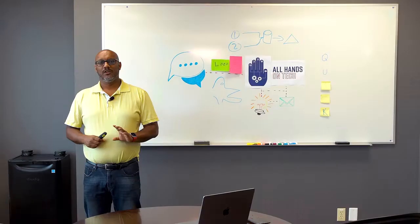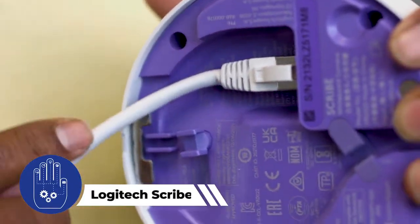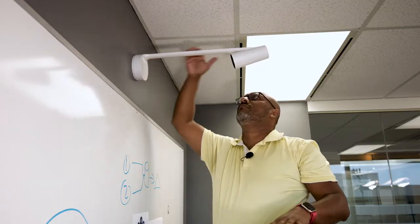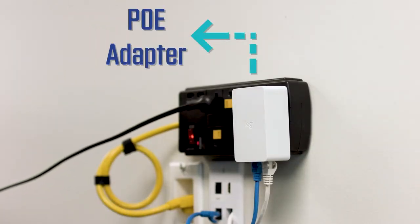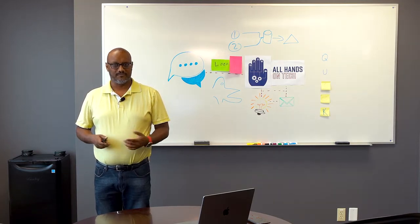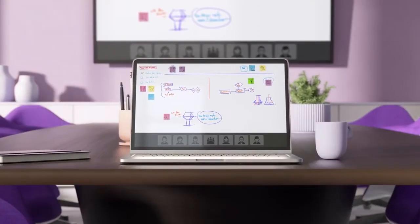The installation will take a bit of planning. It's fairly simple, but there are a few things to consider. You will have to budget some time to run your cabling and cable manage to keep your boardroom presentable. The Scribe uses standard Cat5e cables, which makes things pretty easy and cost effective — you can buy a network cable anywhere or have it installed. It's powered by a regular plug that serves as a PoE adapter, and the network cable also runs the power. To make rebooting easy, make sure the PoE adapter is accessible. We opted not to use a boardroom computer since keyboards and mice tend to walk away — everyone already has a laptop and they're very portable.